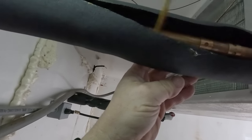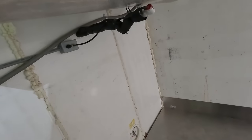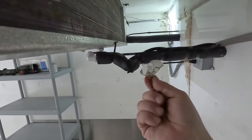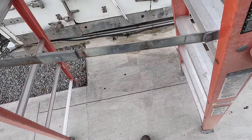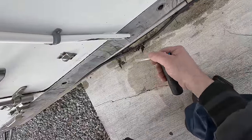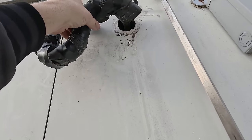This obviously is not going to fit perfectly, but I think we can get it to seal up. Look at this — we've got water there. Drain line's plugged up. That would definitely cause water. It's not wet back here in the back — dry right here. And a little plastic bag like that doesn't help. I bet anything we're not level. Drain comes out here — let's go ahead and blow it out, see what happens. You've got some drainage already. It might be slowing down, but it's not level in that pan.